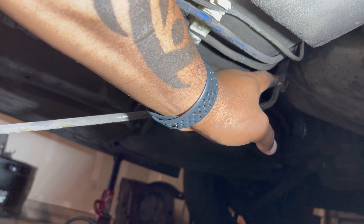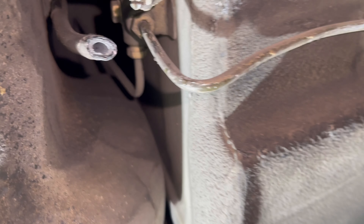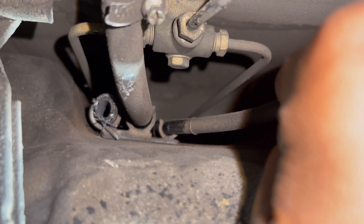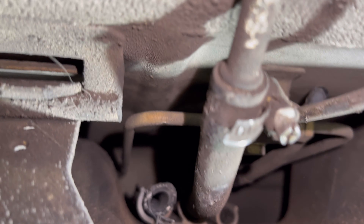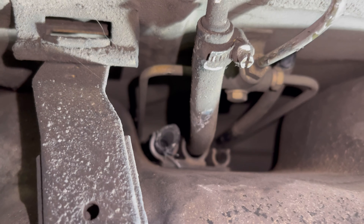See how big the OEM fuel filter is — and all the fuel that came out. The one closest to the exhaust is the return, and the one closest to the inside of the car is the feed. I was under there messing with it and confirmed that. I'm just gonna cut the hose end and pull it out from the top — when I yanked on it from the top this moved upward, so this is definitely the feed and this is the return. The blue line is EVAP — I'm about to push that off. I gotta unbutton it there and pull it out from the top.